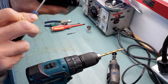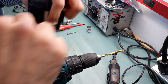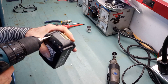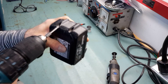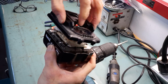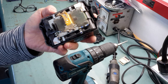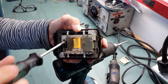I now have access to the hole inside — I just removed the top of the plastic. Now I can use the Torx 10 and reach the screw and untighten it. The battery is now open. You don't need those springs. This is the little BMS here, and you can see there's a screw here and one here — you need to remove those with the screwdriver.